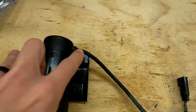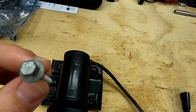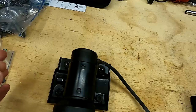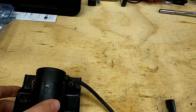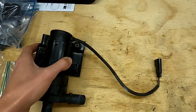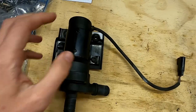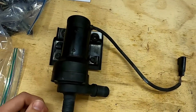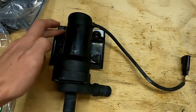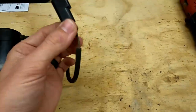The pump itself is this guy right here. These are the two mounting points that attach to the chassis — these are the bolts that come out. Like I said, these are 8mm. The nice thing is they use these isolators, and being a Jag, they are super sensitive about noise and vibration. So the operation of this pump doesn't transfer any vibration into the chassis. You remove those two bolts and the whole assembly comes out, after you remove the hoses and disconnect the plug.